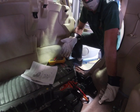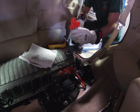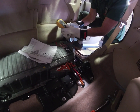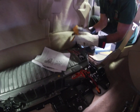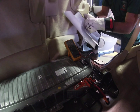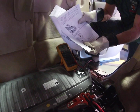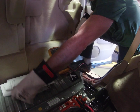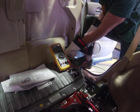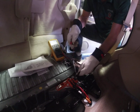You're going to have to wait five minutes before you pull this cover off. I didn't have to because I had that plug out before I started the video simply so you didn't have to wait. Next, we're going to turn the meter to DC volts and do some tests — this is all in the packet. As you have your positive and negative leads coming directly out of your 300-volt battery, we're going to start with that. If we have anything live there, we're going to stop — there's no need to test any further; we've got to wait. If you get the leads backwards it may show a negative voltage, which we're not worried about. And I've got zero volts on my meter right there.